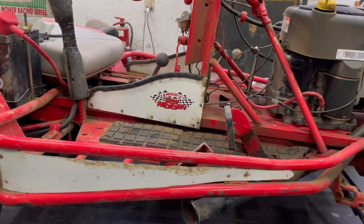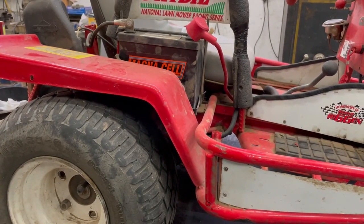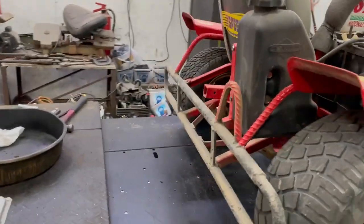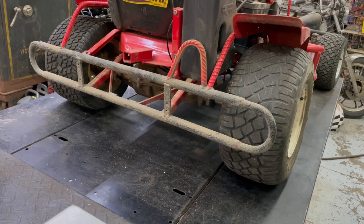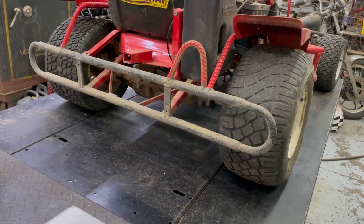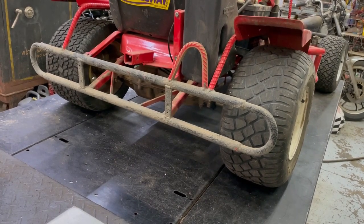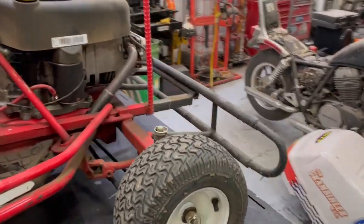But yeah, you have to have a stock frame, and your seat can't be no lower than the back tires. Then on this one here, I have a Peerless 811 transmission in it. Them 811 transmissions have a 1-inch diameter shaft in them. Then you just buy a solid piece of moly chrome axle material and you put it there so it's a solid rear end. And these are oval track racing lawnmowers.